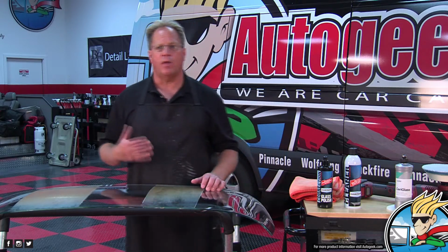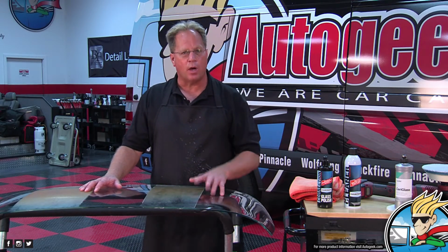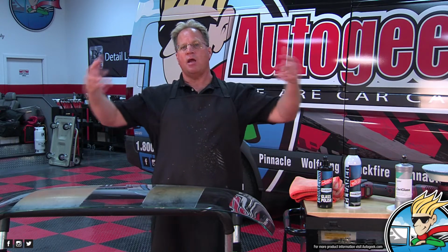So the abrasive technology. Oh yeah, it's just much more aggressive, to make it faster, but also more effective. And anybody that's done a lot of glass polishing knows sometimes you can get the drizzle stains, the water spots, if you've got a lot of calcium or hard water in your rainwater or sprinkler water, or you live in an area of industrial pollution. Even when I lived out in Southern California, that's an area of high traffic in the big cities, and everybody's cars always puking out exhaust smoke, diesel smoke, brake dust, and it goes into the air. Then it comes down in the rain, and settles in the dew, the liquid film that forms on your glass, and it becomes a film. So some glass really needs a lot more aggressive abrasive technology than car paint.